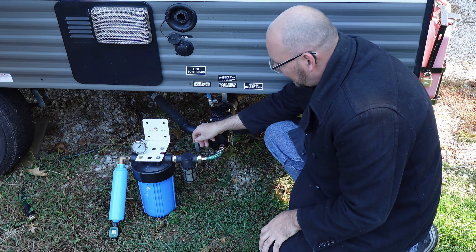I hooked this thing up with the out port not at the bottom and not at the top. My thought is if I hook it on the bottom, any big garbage from the sink could clog the filter. If I put it on the top, oils have a higher chance of getting sucked in. So if I put it in the middle, the oils stay at the top, the big chunks stay at the bottom, and it sucks out the middle area. Then on those occasional trips to town to drain your gray or black tank, you can do a complete gray tank clean out.